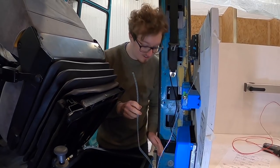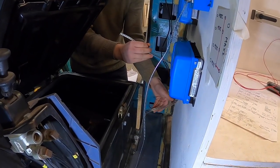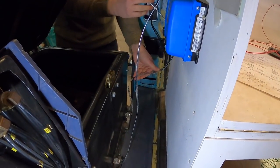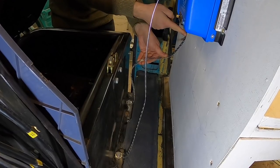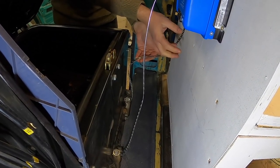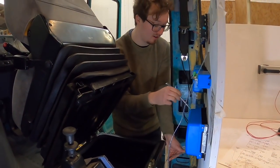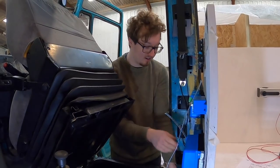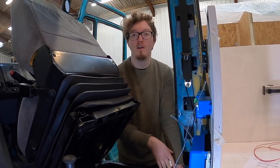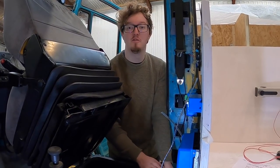So that is our banding attached, so the batteries will slide in there, and then that will go over the top of the battery, well away from any of the terminals on it, and then we're going to screw in at this point here, which matches up, through our 18mm ply and into our 2x2 timber on the back side. So that'd stop them in the worst case that we flipped the van over or anything horrific like that. That'll stop them flying all over the place. They're pretty trapped in here anyway, but just an extra bit of band.